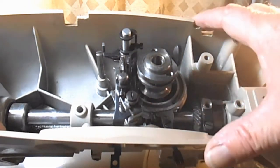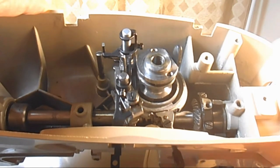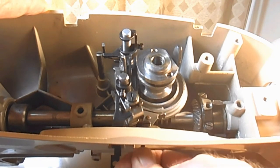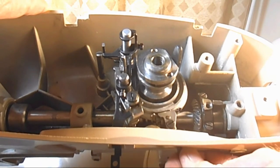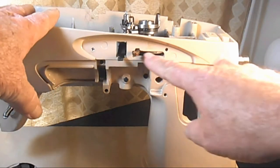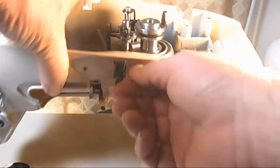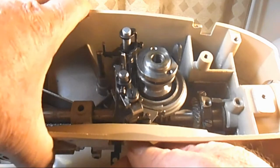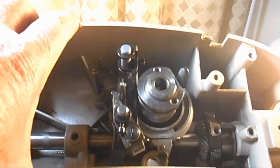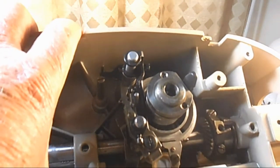And underneath it are two what's called stop plates. So you have to set the limit of the bite amplitude. And it's not really the space up here that sets the limit. It's the stop plates underneath that set the limit. And so I'm going to need that other light again.